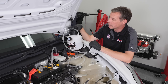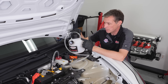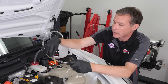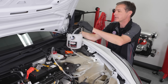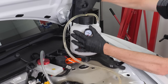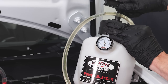I went and put basically three pints of brake fluid in this thing. The bottle is really heavy duty — it's got a gauge on the front, and the pickup tube is actually molded in all the way to the bottom. It's got a typical connection like you'd have for an air hose system. Pop this handle loose, pump it up to 15 psi, and we're ready to do business. Now we just head back to the car, start cracking the bleeders loose, and cycle out all the old fluid.